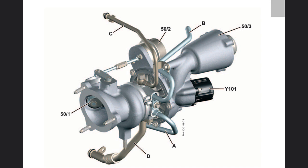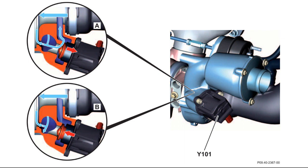The pressure sensor upstream of the compressor impeller is located in the charge air line upstream of the turbocharger. Due to the inertia of the shaft, the compressor impeller and the turbine wheel, the turbocharger always spins on slightly after the vehicle starts to decelerate. Because of this, a boost pressure surge runs back to the compressor when the throttle valve actuator is closed quickly. This boost pressure surge causes a situation at the compressor impeller where there is a low delivery volume and high pressures, which leads to so-called turbocharger whistling, brief howling and mechanical stress. In order to prevent this boost pressure surge, the blow-off valve opens and quickly releases the pressure in the intake line. When the MI-SFI control unit detects the transition from load mode to deceleration mode, it actuates the blow-off valve. The blow-off valve opens the bypass at the compressor impeller and the boost pressure is reduced. In load mode the blow-off valve is closed by an integral spring.